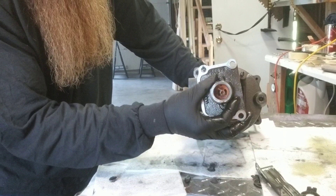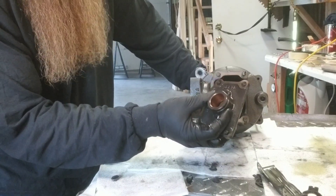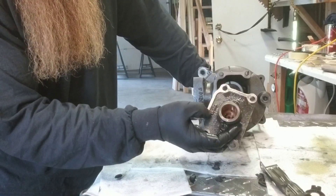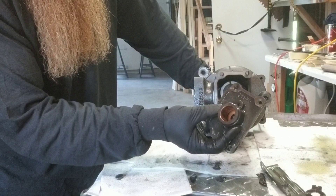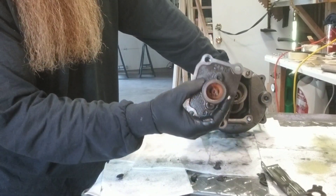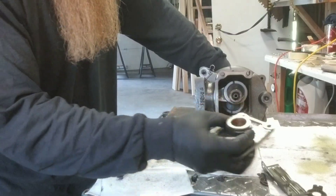That bearing really doesn't have much wear. It is copper plated, but I believe that's on purpose from the manufacturer — that's not copper plating caused by acid. Some of these systems, if you get acid mixed around in the system, it'll actually pull the copper off of the inside of the copper piping and deposit it in the motor, usually in the piston heads, cylinders, or sometimes in the bearing. But I'm 99% sure this is just copper plated from the manufacturer to let it last longer.